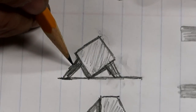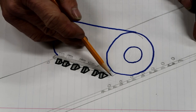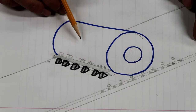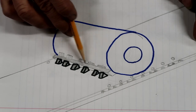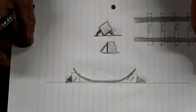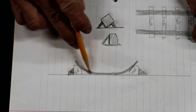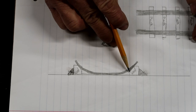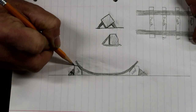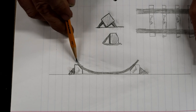Going back to the first illustration: your coil racks are set up, your timber is underneath, and then you have the rubber mats under that to prevent any damage to the coil, to raise the coil above the timbers, and to keep it off the deck and the bottom portion of the rack. From a side view — standing on the ground — you've got the top of the trailer, then your coil rack going all the way over, then either your bevel timber or square timber, and then you take your rubber pads and lay them down.